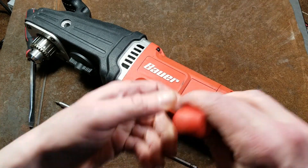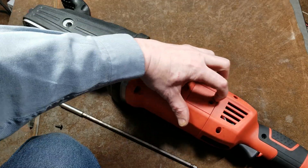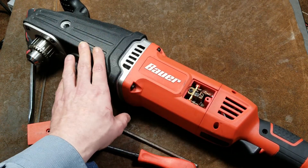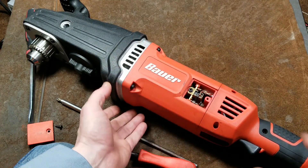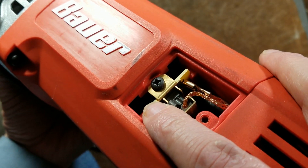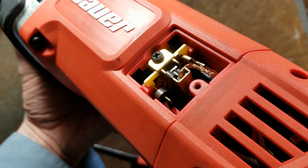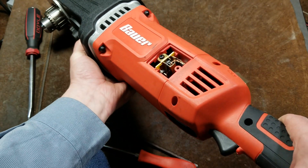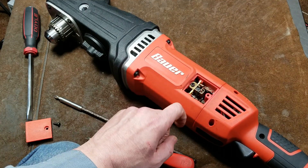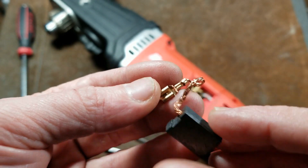I've generally learned my lessons about pulling out the brushes when pulling off the gearboxes. About half the time the motor stays in the back of the housing, and half the time the bearing gets stuck in the front diaphragm. They hardwire the brushes in a brass guide, and interestingly use a little fiberglass PCB circuit board rather than plastic backings — more heat resistant, which is relatively intelligent. A clock spring presses on the back. These are auto-stop brushes, because it stops the spring from advancing the brush and the wire catches. They're using a special all-copper crimp terminal on the end of that braided wire.